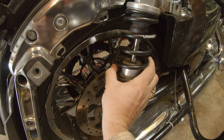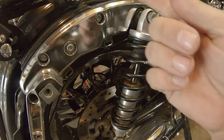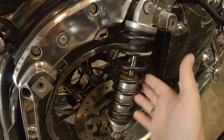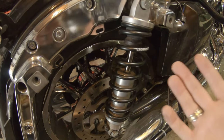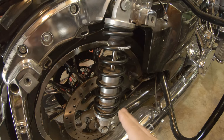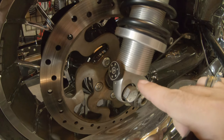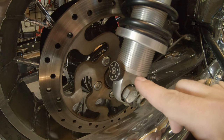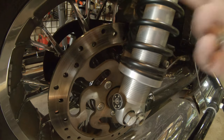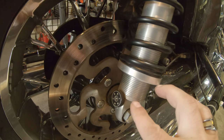My buddy's here. I think I need to soften the suspension, which means grabbing this and twisting it — clockwise looking top-down, so to my left — giving it a full rotation on both sides, then sitting on it and having him measure. If we're not there yet we'll give it another half turn, quarter turn, or one full turn, whatever we need to hit 12 inches center-to-center. I've got about an inch and a quarter of thread space on both sides and they're already matching, so I'm not fighting a mismatched pair.